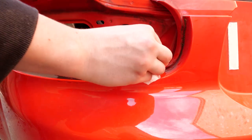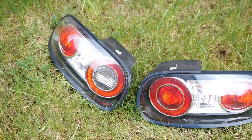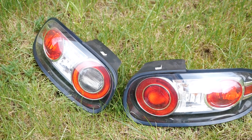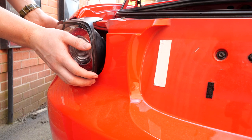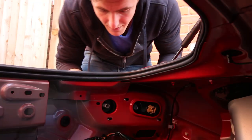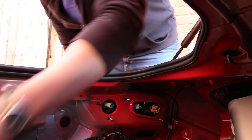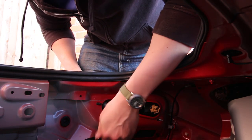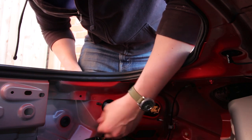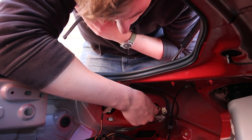I took this opportunity to clean the rear light housings whilst I could, and I did the same for the rear lights as well. From this point it's really easy because you know how it goes back together because you've taken it apart. Replace the three 10mm nuts and plug the connectors into the rear light — you're going to know which one goes where.